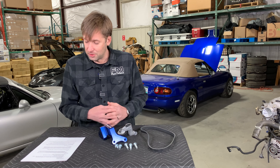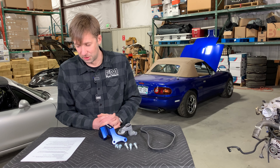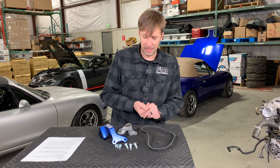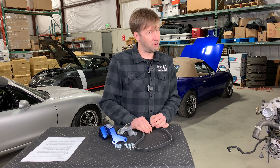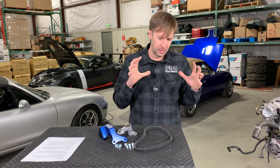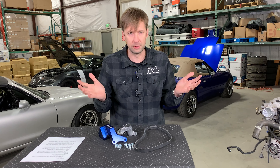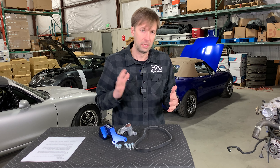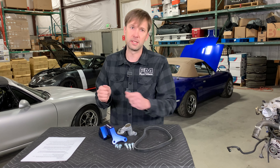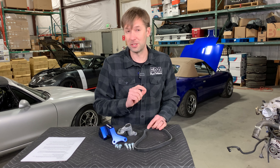What needs to be done to the steering rack after removing the pump? What's involved in depowering the actual rack? Is this all I need to delete my power steering? Literally, almost - but I would not recommend it. The power steering pump is a hydraulic pump that pumps pressure to the steering rack depending on what the position of the steering wheel is telling it to do. There are lines, there are fittings on the rack, and there's a piston inside of the steering rack. The pressure pushes on this side or that side to assist in your turning.